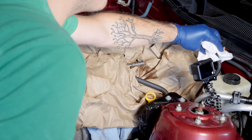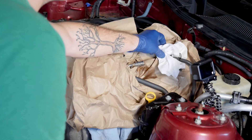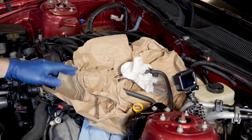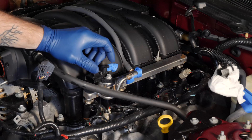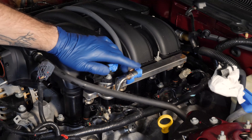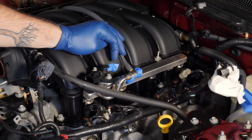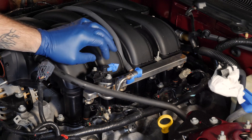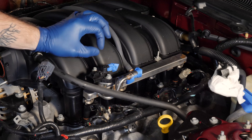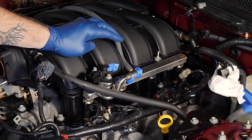Now we just want to set this up and wrap something around it to ensure that we don't get fuel dripping into the engine bay. I'm going to clean this up, and for the radiator — it should be fully emptied now — I'm just going to close that valve and drop the car back down to normal height. Now that we have the vacuum hose and the electrical connector for the pressure sensor gone, and the fuel line removed, we can start taking the rails off. There are four studs that need to get removed, two on each side. On the other side, you do have to remove two tie-downs for the loom for the positive lead on the alternator, but then once that's free, just remove all four of the studs.